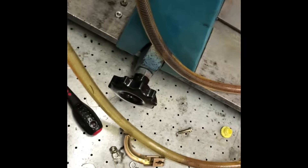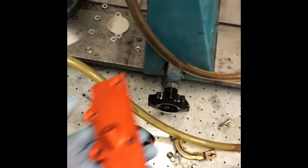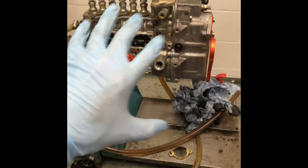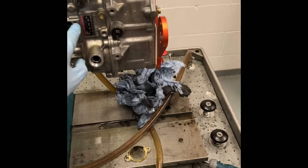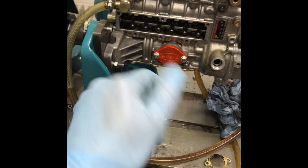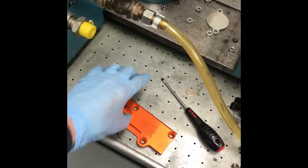Now the other thing that this plate provides is rigidity to the side of the pump. It's very thick — much thicker than the original, even the aluminium version — and it stops the distortion that can happen when you tighten the bolts into the side plate. It's quite common to find that a lot of these custom injection pumps, it doesn't matter who built it, if you have one that particularly jerks a lot, you tend to find that if you slacken off the actual bolts in the side it stops it. It's simply because the aluminium in the side gets very slightly distorted when those screws are tightened, and that causes that jerking effect. With this really thick side plate, we have a cure — nice and thick, perfect.